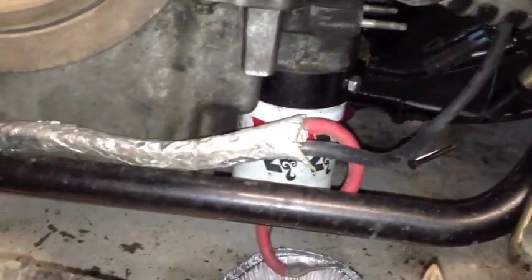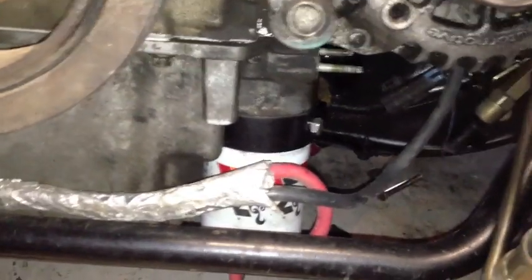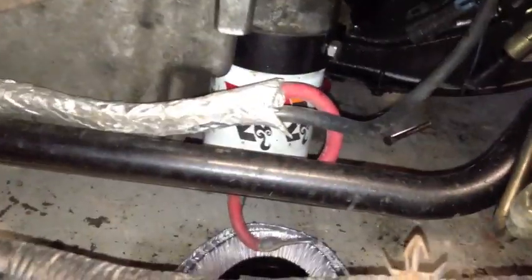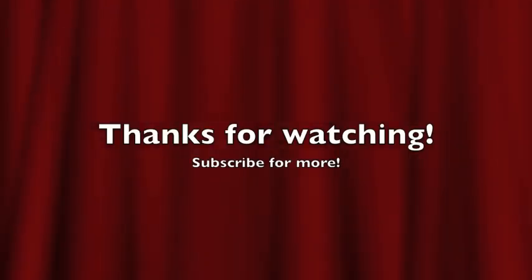But basically, right now what I'm going to do is pull off the filter and take that little spacer thing out of there, and put the oil filter back on top and then put the sender in, which doesn't look like it's going to have any interference issues, I hope, but I need to put some of that stuff on there. Got that done?